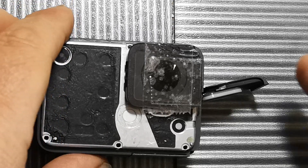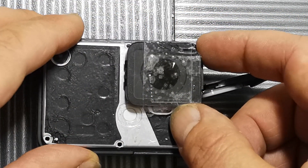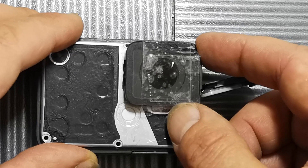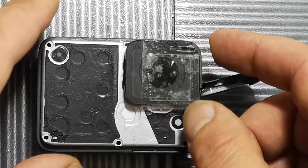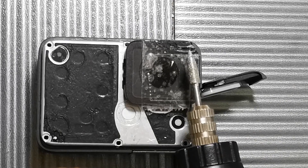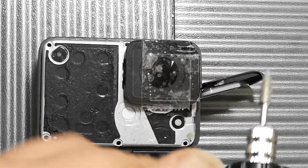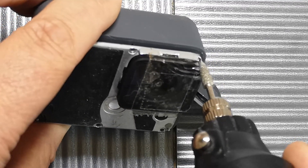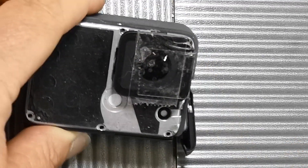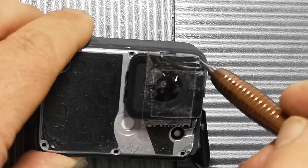The trickiest bit is the corner of the lens. The lens housing is over the Torx bolt so you can't get to it. This is a really bodgy way of doing it and it's not the best way, I'm sure, but I couldn't find a better way — if anyone tells me a better way I'll put it in the comments. I ended up using a grinder tool — not a Dremel, a much cheaper copy — and I just buzzed away at the edge there and made a space to fit my screwdriver so I could reach the Torx bolt underneath and undo it.